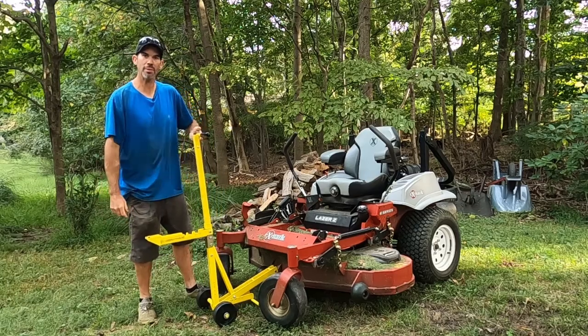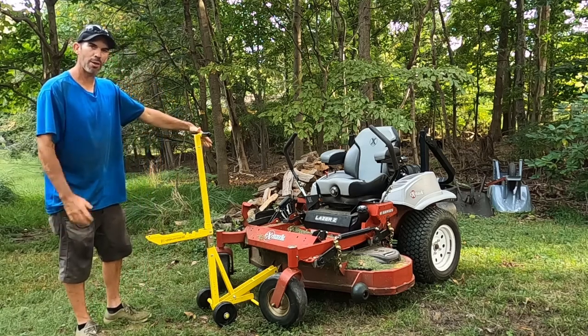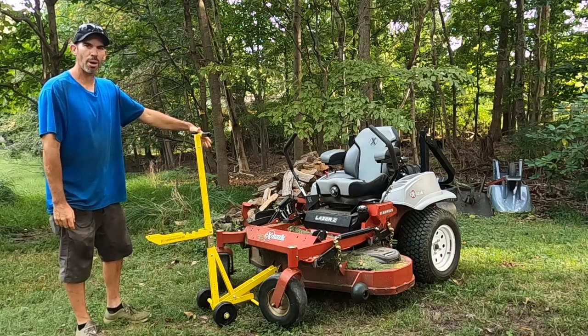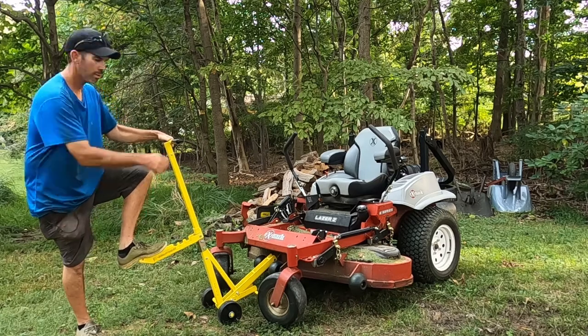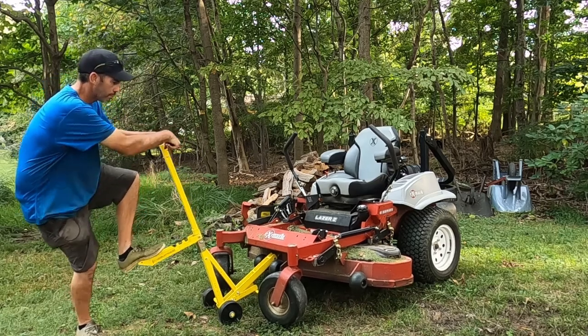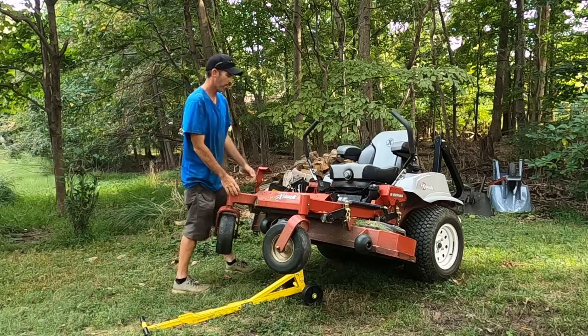Once it's hooked up and tight, what I like to do is use my left foot and in one fluid motion, lift the mower up. If you try to lift it slowly, you can't lift it. Push down, take up all the slack out of the mower deck. Once it's up, now you can come over and set the parking brake